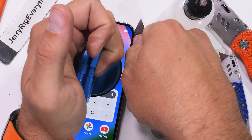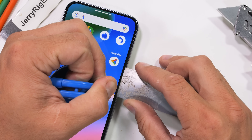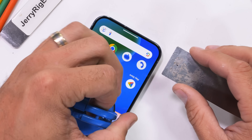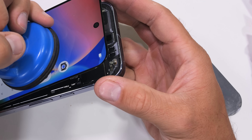Making sure that my tool does not go deeper than just the black bezel until I'm positive that I can reach underneath the AMOLED panel, since if something touches the edge of that panel it'll break the display. The only reason to remove the screen is if it's already broken, so this level of care and precision isn't normally required on a damaged phone. I'm just attempting it with the screen on to prove that it's possible.